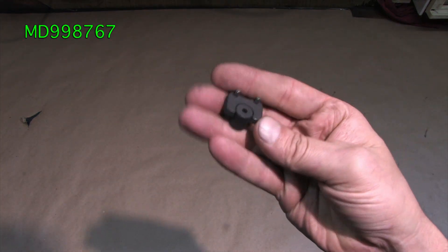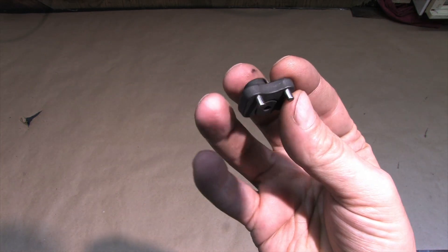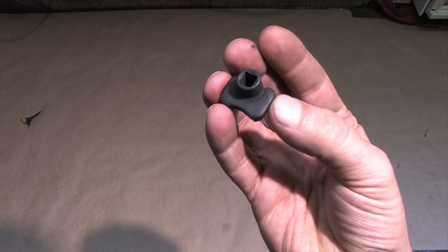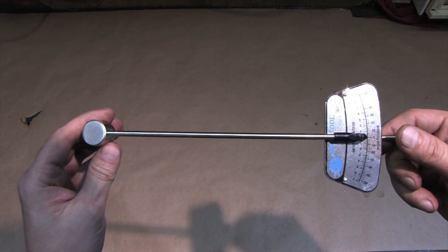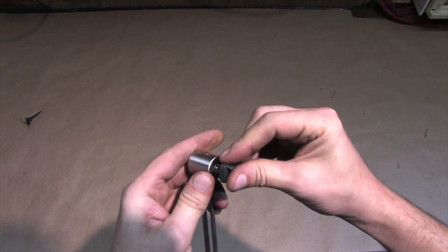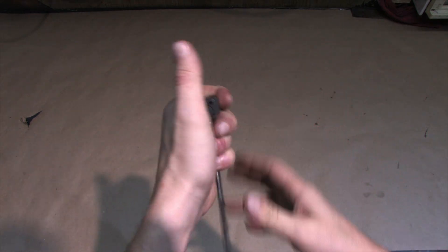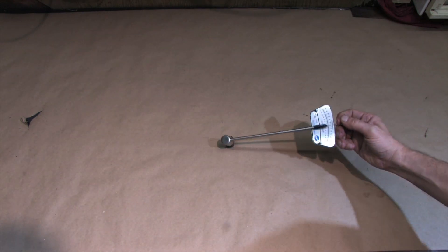This is an eccentric pulley tensioner tool, which I'll always refer to as the happy face tool. It's got two pins that are offset from the center on one side and a quarter-inch drive socket adapter on the other. If you don't have this tool and you're doing a timing belt job on a 4G series Mitsubishi, you're only going to get your timing belt tension correct through guesswork — you have to have this. You'll also need an inch-pound torque wrench. Clicker-style torque wrenches are completely inadequate, so use the smallest resolution needle-style inch-pound torque wrench you can find. I prefer the Park Tool TW1 60 inch-pound torque wrench. The 60 inch-pound resolution makes it really easy to read the tiny amount of preload required while you torque down the center bolt of the happy face pulley — that's 26.4 inch-pounds on a 1G and 31.2 inch-pounds for the 2G.